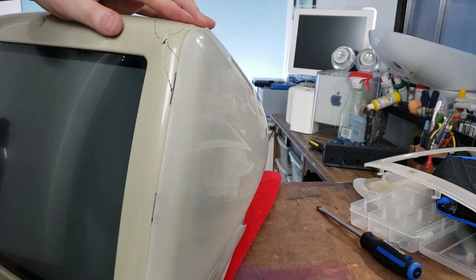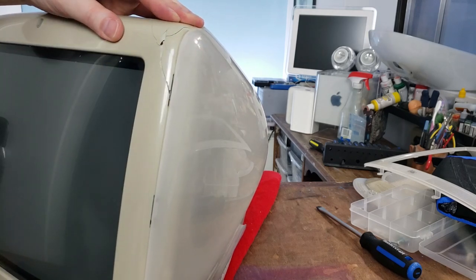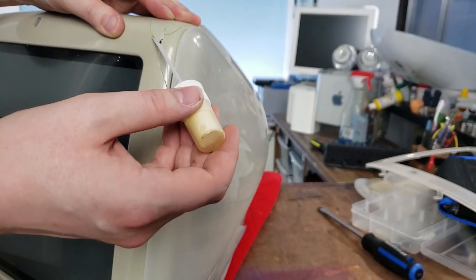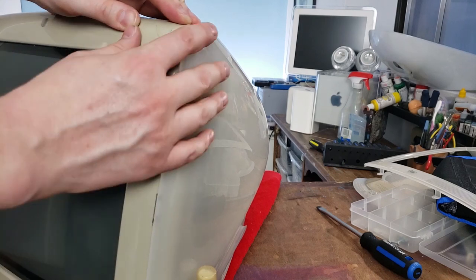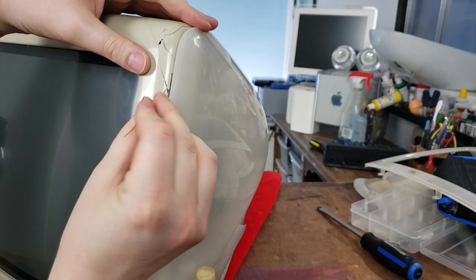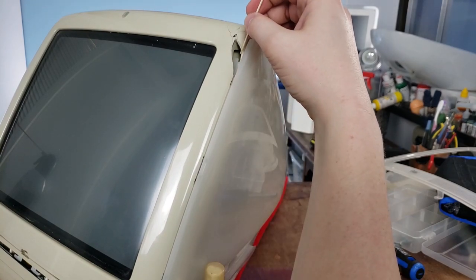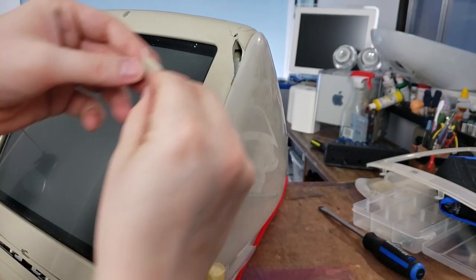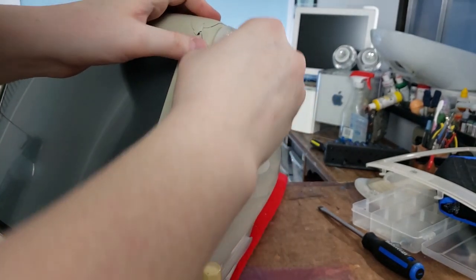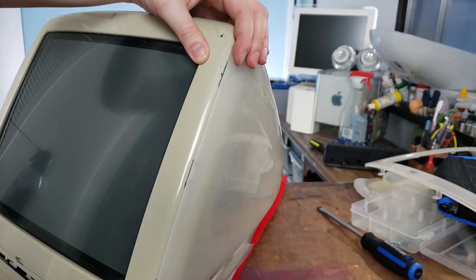The last thing you want with superglue is overflow — it looks absolutely dreadful. And this is instant bond. Another thing you want to be careful with in this sort of repair, because instant bond can actually cause the superglue to turn yellow, and it does generate heat when you put the two chemicals together, so you do have to watch for that. A little more superglue going into the cracks and crevices, fit that back in. A little more instant bond — James Bond, Michael Scott.